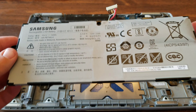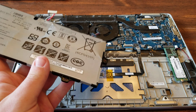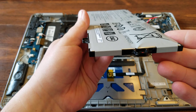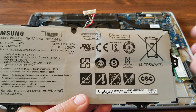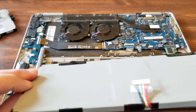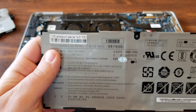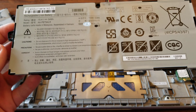Simple as that, it comes right out. If you ever start to see your keyboard lift up, or your mouse pad, or anything like that, you probably have a bulging battery, which is extremely dangerous. The gases in there will continue to build up if you continue to use it and charge it, and eventually they can explode. So you want to get that replaced right away. I got this specific battery from batterymall.com and it cost me about 85 bucks, but it's a lot cheaper than buying a new $1,200 laptop.